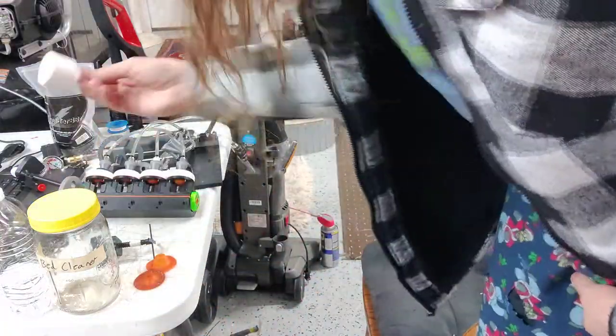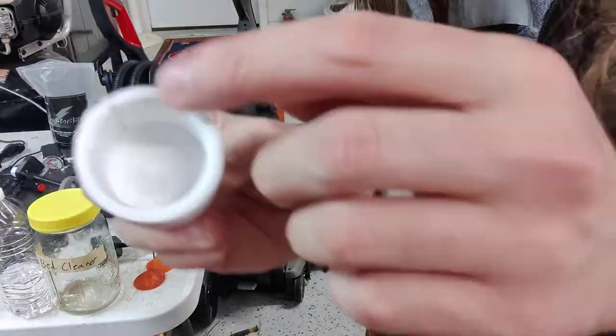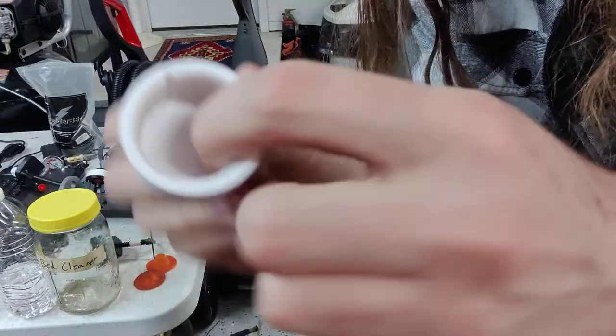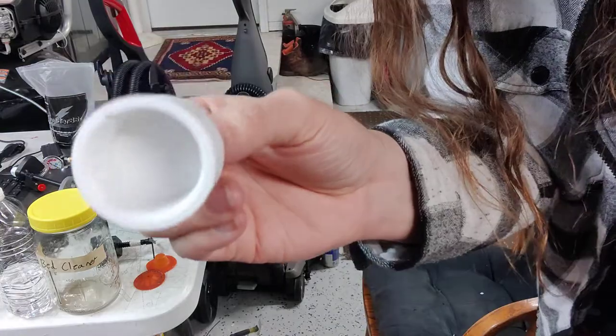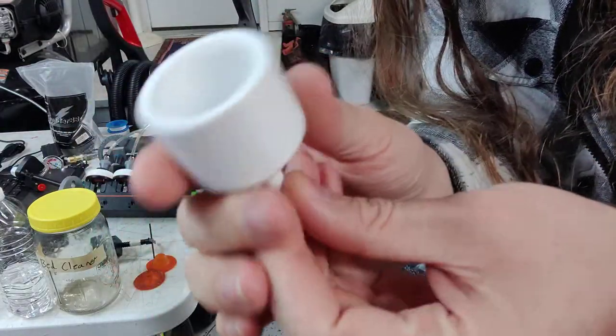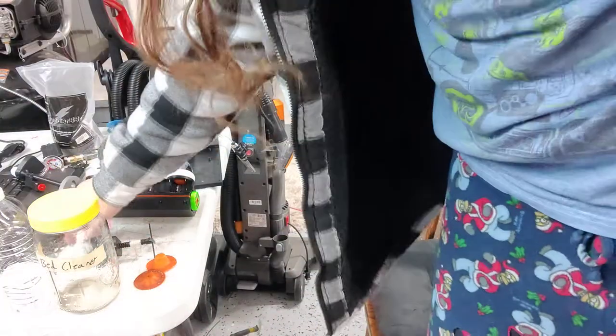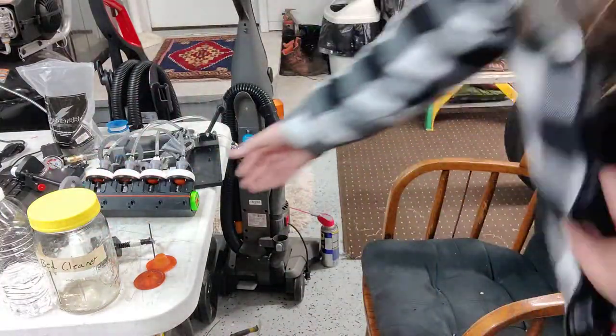This is one of the other tools that comes with it, for instance. You put the sleeve in there — it's got the sleeve keys and the same profile as the sleeve as the engine does. It's meant for you to put it into a chuck, and it allows you to sand the inside of the sleeve.